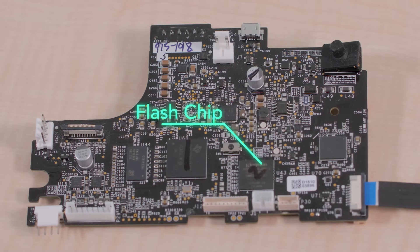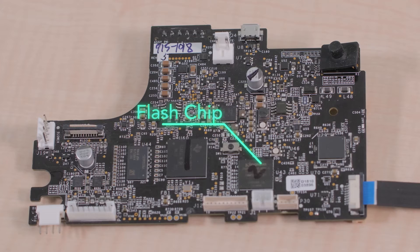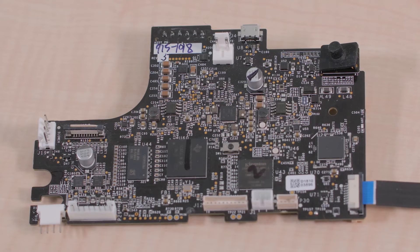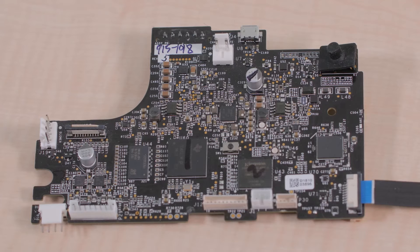Researchers in Germany who analyzed security aspects of the D7 report the MCU is actually a custom AM335X Sitara processor chip with secure boot enabled, meaning the D7's flash chip — a 4 gigabyte NAND device from Kingston Technology — only contains an encrypted system image. This means physical attackers can't unsolder it to get at the robot's software.